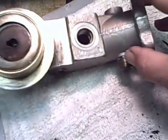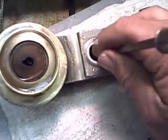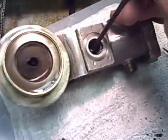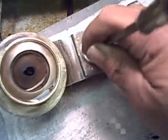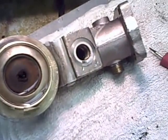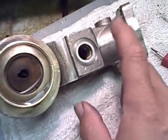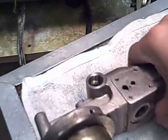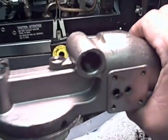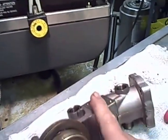Make sure you clean this out because it gets a lot of coffee buildup. It's only accessible when you remove the group head, but through normal back flushing you can also remove this cap and back flush that way if there's a lot of coffee grounds in there and you don't want to remove the group head. This cap is normally hanging this way in the group, and it sits right under the group valve.